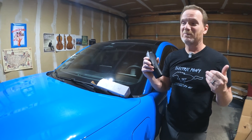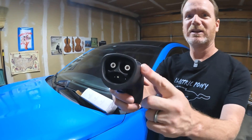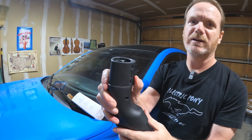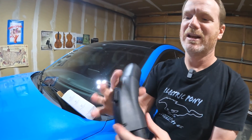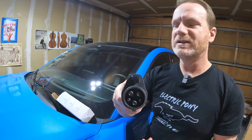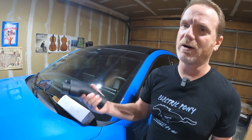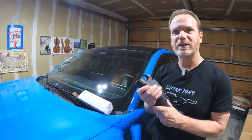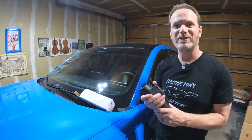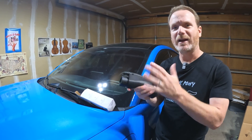As you can see, it's pretty simple to use. The device is really simple — you just plug the Tesla handle in here. It actually clamps on with this lever underneath. The other end is just like your normal J1772 connector with the release lever to clamp onto your charge port of your Mach-E, or other EVs that aren't Teslas. It feels very solid and sturdy. It handles up to 48 amps of power, which is good enough for getting your Mach-E or other EV charged. It's solid but compact.